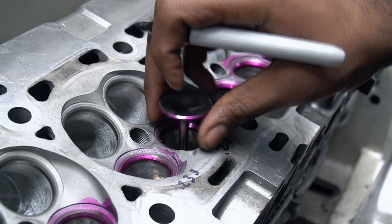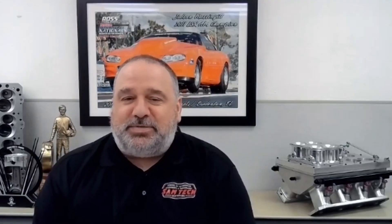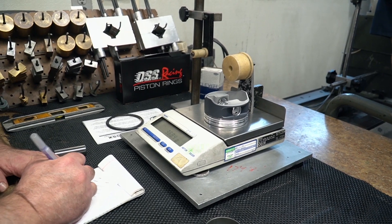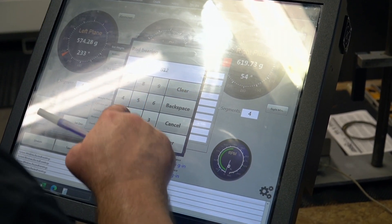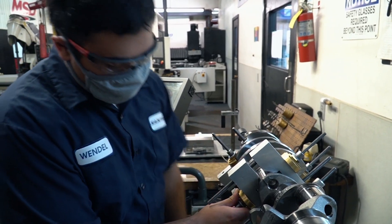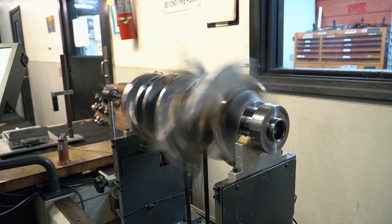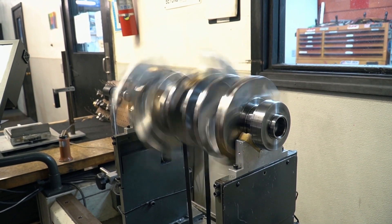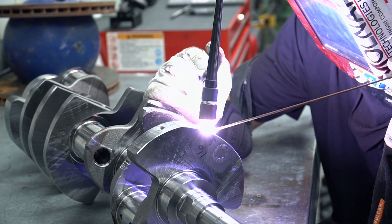Another aspect that is very, very important in any sort of high-performance build is balancing. This is my OCD — between that and surface finish on the hone, those are my two favorite machines because there is such a large variance. Do I put 2% in it? Do I take 2% out? Setting up and getting the correct bob weight is very important, but the finish balance numbers — the right offset or the left offset numbers — they need to match. The couple needs to be 180 degrees out. We will get a better finished product.